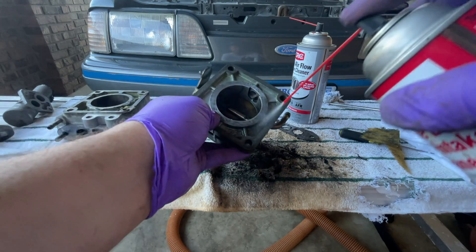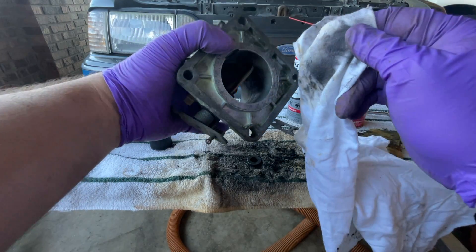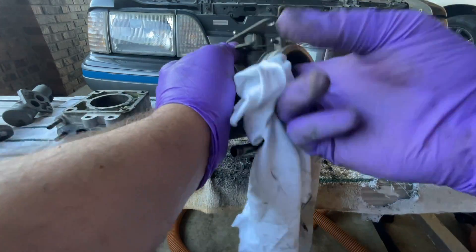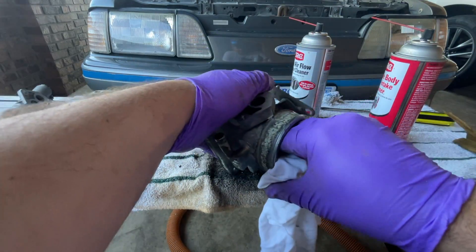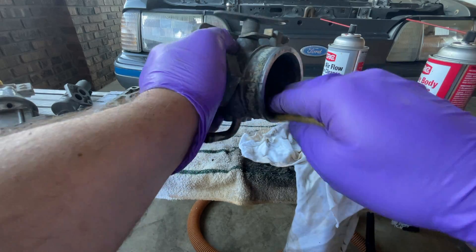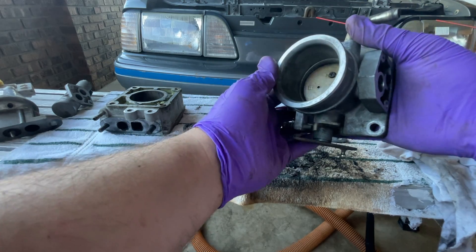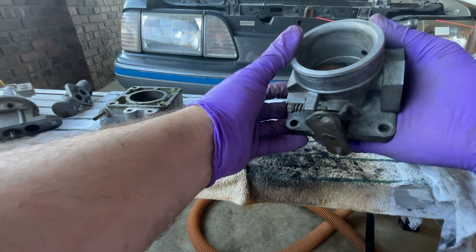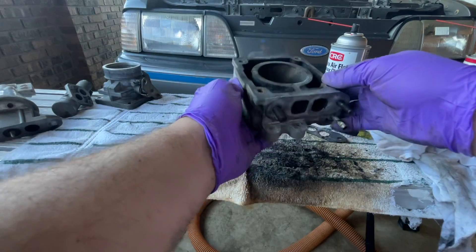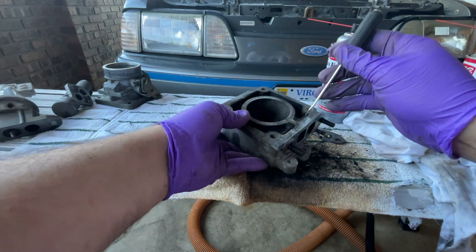You can open it up, kind of put your fingers through the butterfly valve — just try to wipe it out real good and stick your fingers through on the butterfly. I'm going to take some of this and smooth it up a little, nothing major. Here's the throttle body — it looks like it's actuating well, so we'll let that dry out. Then we've got the water jacket, and this has a massive amount of buildup in it.